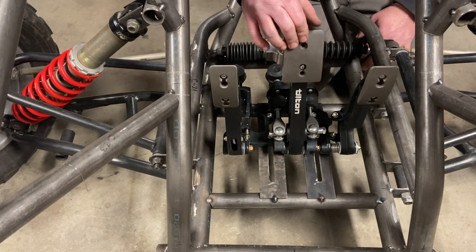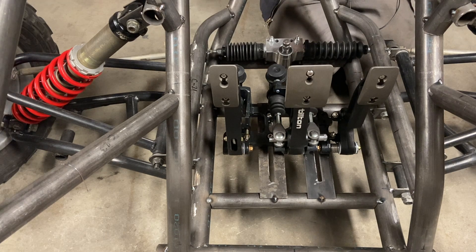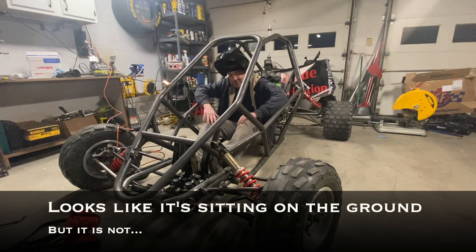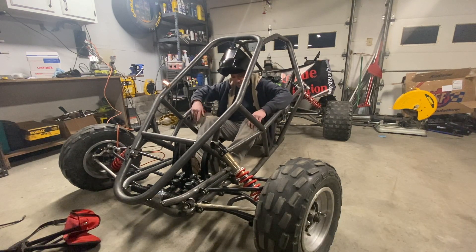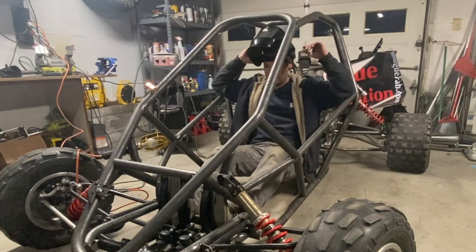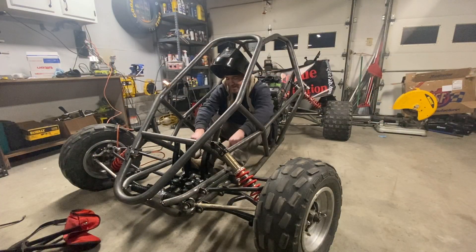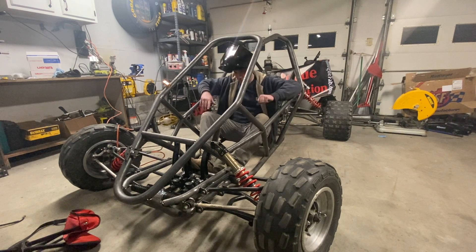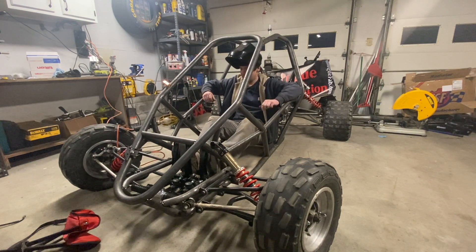Not super hard today — pretty easy, pretty fun. That does it for the racing pedals. We'll go through and put the brake lines on; that'll be a different episode. I'm really tempted to pull the racing seat out of one of the other carts, but the one for this shows up tomorrow. As I'm sitting now, I've got a bunch of leg room. I only took half an inch off of all of those brakes and everything. You could take more off — just be careful how much you take. The first one I did, I took a little too much off. Work your way slowly to where your pedals feel good.